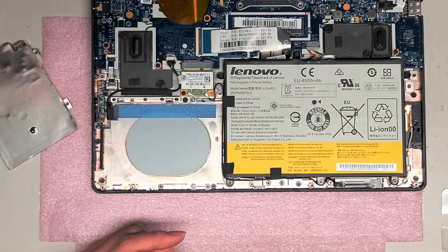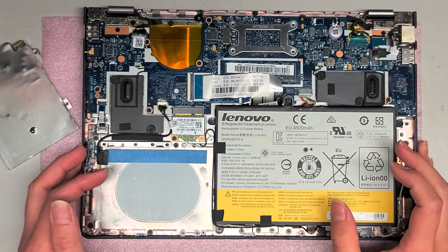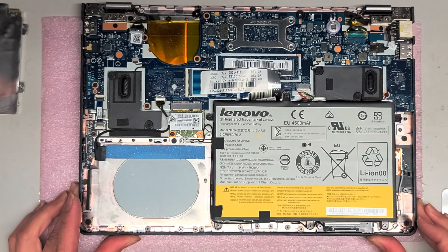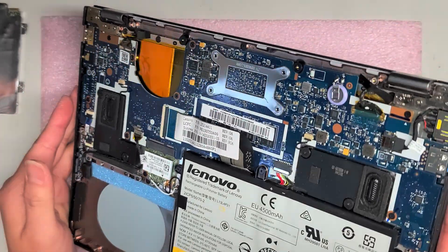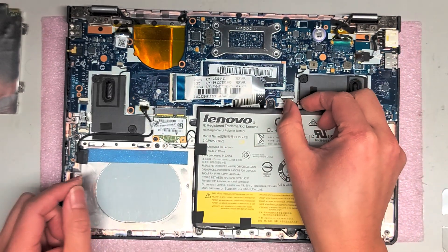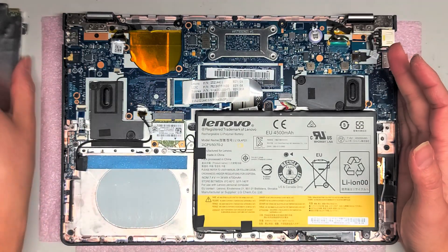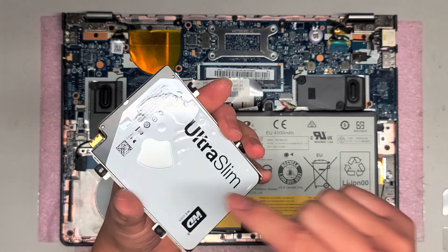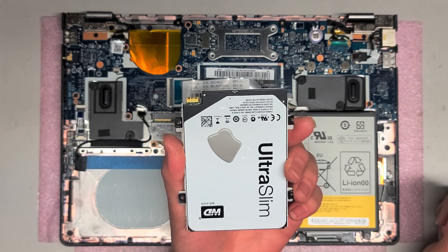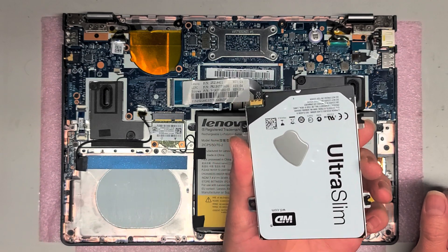If you have any questions, leave them in the comment section below. Make sure you watch the whole video before asking questions. These kinds of connectors are just pull connectors — grab the cable as close as you can and wiggle it to pull it out; don't yank it straight back or you can damage it. You'll have to look for an ultra slim SSD adapter — make sure it has this type of connector. They do have mSATA adapters for this, but as far as going to an M.2 or a regular 2.5 inch SATA SSD, you wouldn't be able to do that. Thanks for watching and I'll see you in the next one.